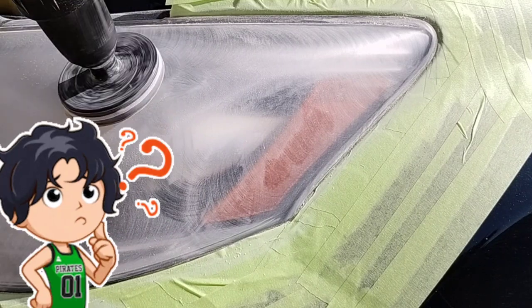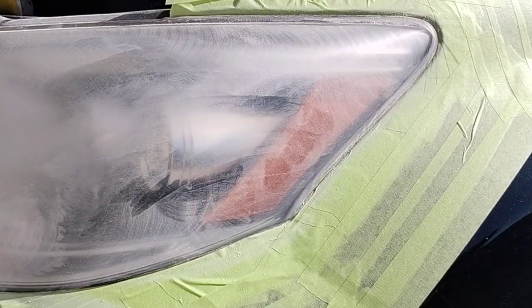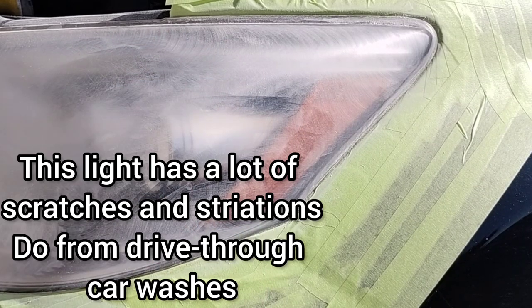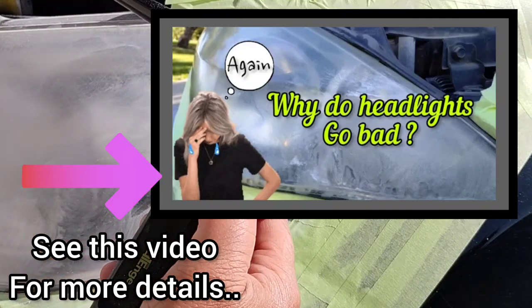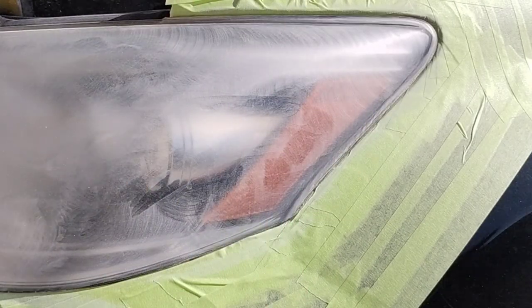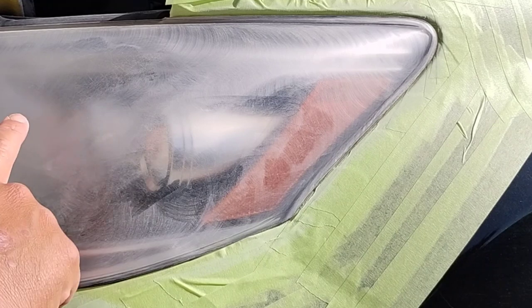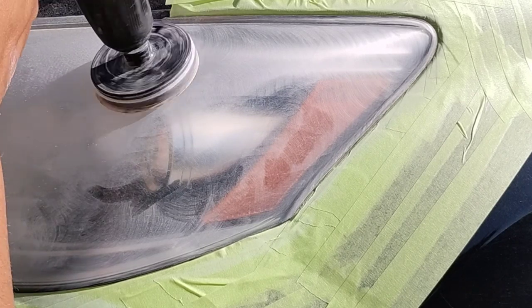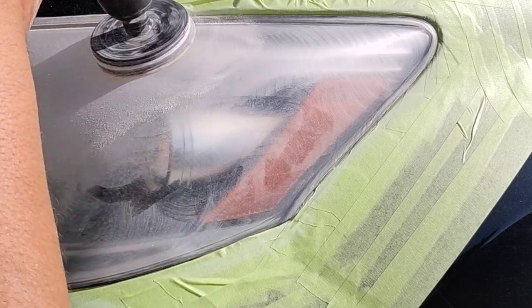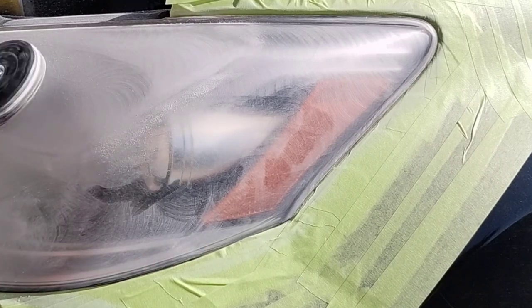I have a lot of questions all the time about what speed to use the drill on. There are two speeds with any given drill, even my polisher — one kicks it into higher gear and the other is lower gear. But with either one, you can adjust the speed by how you feather or squeeze the trigger. It will change the speeds from barely rotating to going 1700 RPM. In those bad areas along the edges, I'm actually throttling down to maybe 500 RPM, and when I hit those flat areas I'm gunning it up to about 1750 RPM.